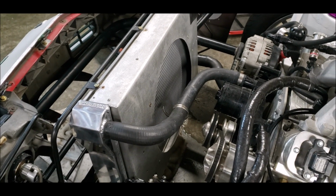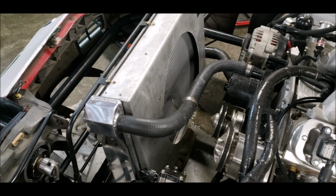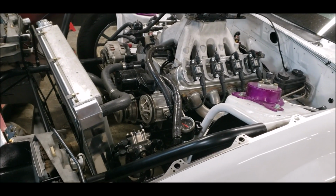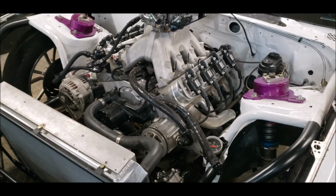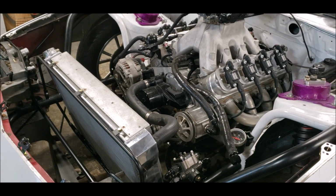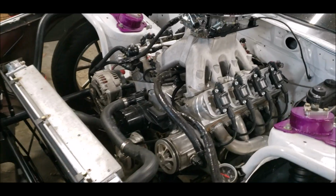I think I'm at the point where I should probably put the fan in, and then I'm gonna lift this thing up and I'm gonna try and drain as much of the coolant out of the block as possible. I just feel like since we're concerned about a potential chemical reaction as part of the reason why this thing was overpressurizing, it would be just a good idea to try and get as much of the coolant out as possible.